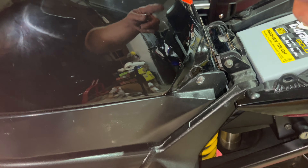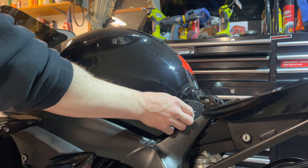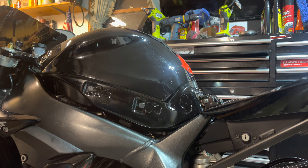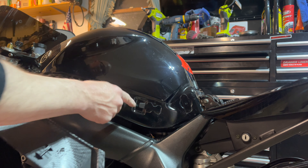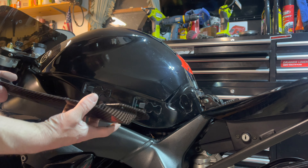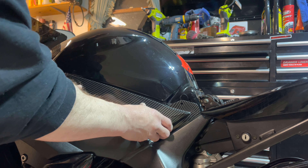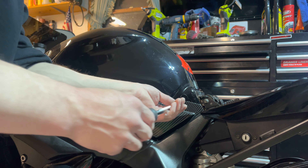Next we're doing the gas tank trim. Take out the two seat bolts that are right under there and under there, then take out the two Phillips head screws on this side and that side to remove the gas tank trim. After the bolt is out, pull it towards the front of the bike and it comes out just like so. Next, to install the trim, you'll see that you have these two little brackets — they go into here, so push them into the slot and then push it back, line this up in the slot, and then just pull it back. Then just install the screw.